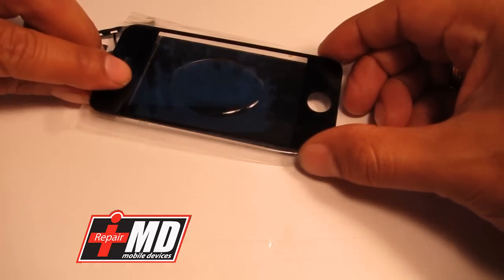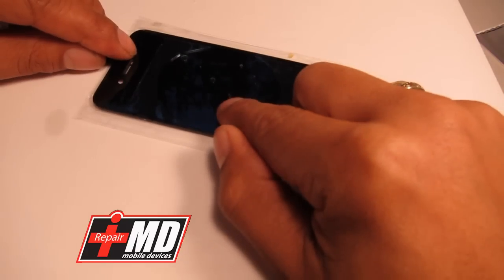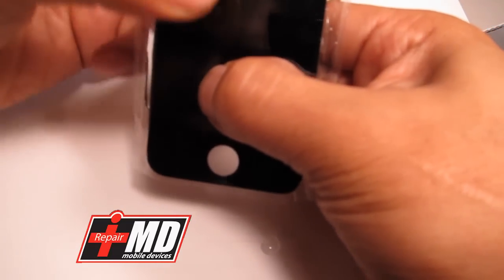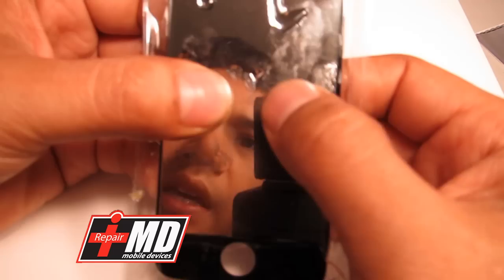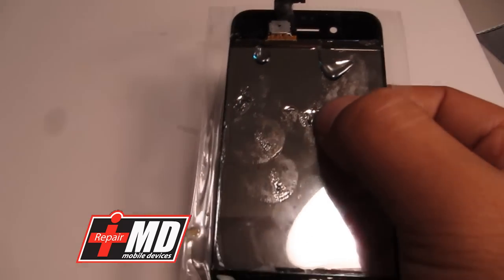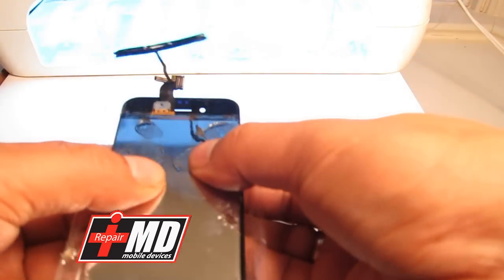I place this glass right on top, pushing it gently. Now I'm lifting it up and working the bubbles out. I'm aligning it, making sure all the bubbles are out — visually checking the front. No bubbles at all. Now I'm going to turn it over, meeting the alignment gap — you can see the space — so I can align it from there. Now I'm turning on my UV lamp, setting the time for five minutes.